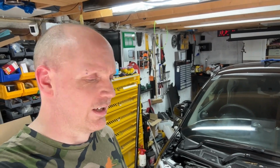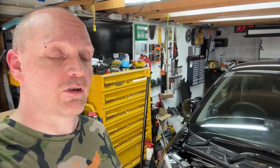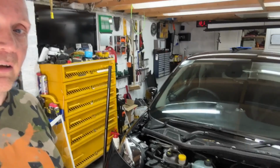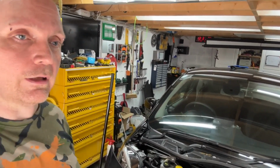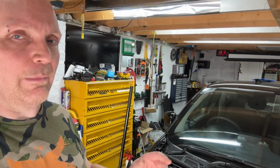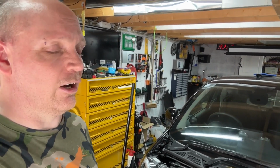Right, it's some days later. I didn't really do much after the last video. I have just emailed Smart about replacement headlights. I've been trying to code the LED ones. For some reason on the facelift version, DDT4All will not connect to the car. It won't find the EME controller, so I can't actually do that. And I did try with Vediamo, but if you've ever tried using Vediamo, what a piece of shit that is.